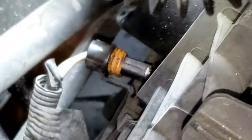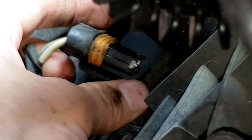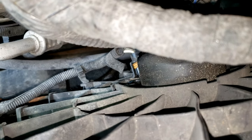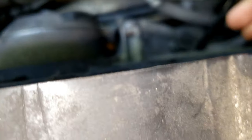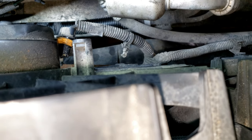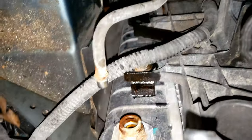Now you want to get those fan plugs out — there are two of them. You can tell these aren't just normal clips; you've got to pull down instead of push in — that's how you get these out. There's two of them. Then there are a bunch more tedious little jobs — you've got to get all those push-in wiring harness holders out. There's one all the way down there on the right for this wire, and then over here there's one for this wiring harness.